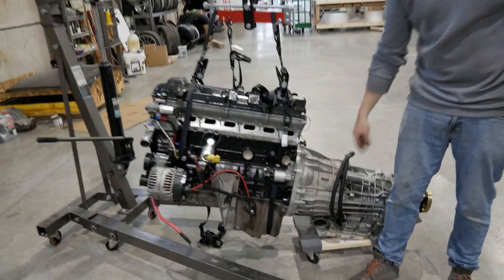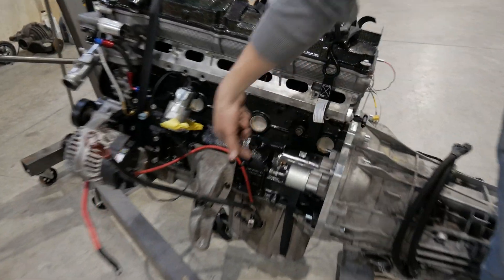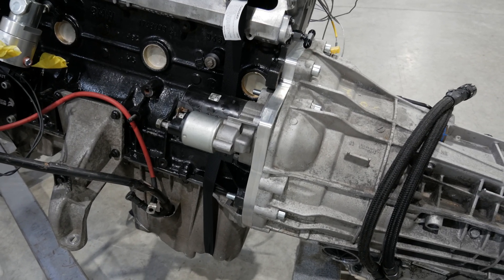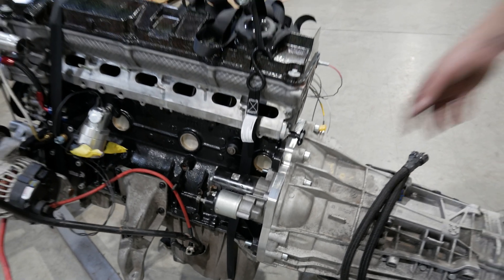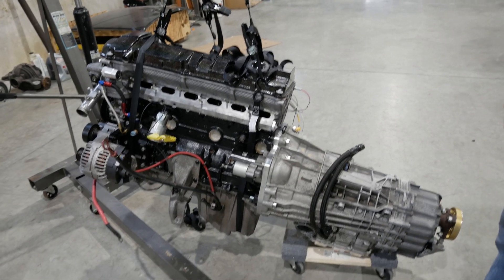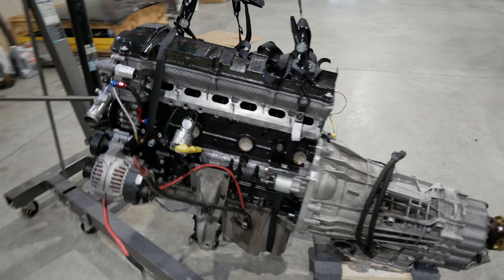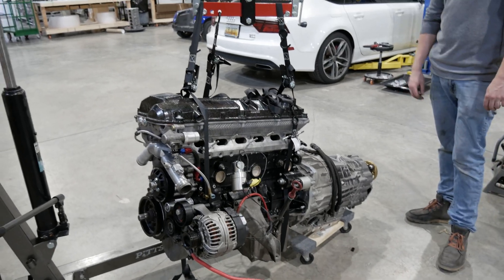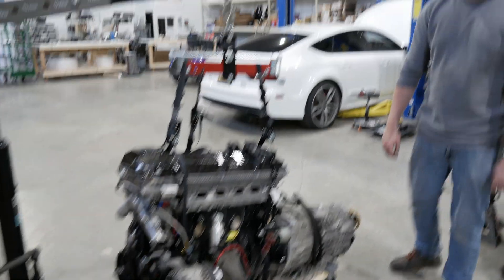So here we have the Atomat adapter and the starter in place. The starter takes one bolt in from the back and one bolt in from the front, just like OEM — so it's pretty sweet. There's no more drilling or welding on the case anymore. I did like 100 foot-pounds on the M12s. I'm pretty excited to get this thing back in the car.